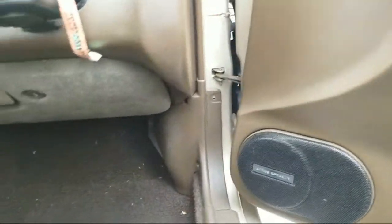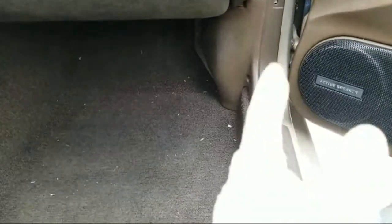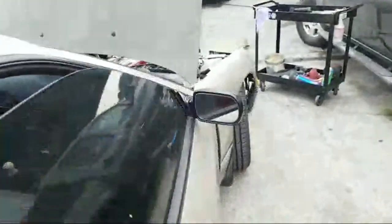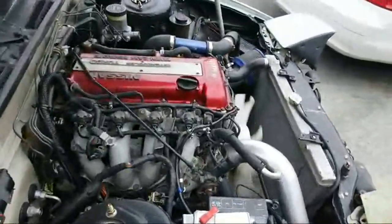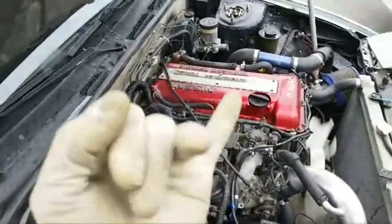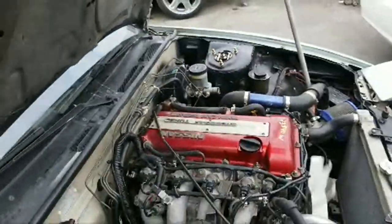If you have the S13 S240SX from your original harness, you're gonna have to chop it. Use the original plug into the interior or the dash, and you're gonna solder it. You're gonna weld it, whatever you can do. What else? That's about it. New pump. Remove the power steering column, the connecting to the rack and pinion.